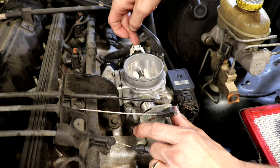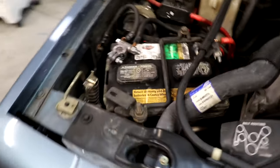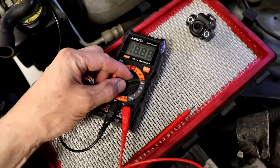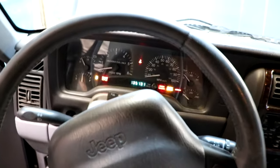Let's hook up a multimeter on the back side here. We'll find our ground, our power supply, and our sensor. We're going to hook our multimeter up to a good ground — this is long enough so I'm just going to hook it to the battery. Turn the multimeter on to 20 DC volts, and we're going to turn the ignition on but not start the vehicle.